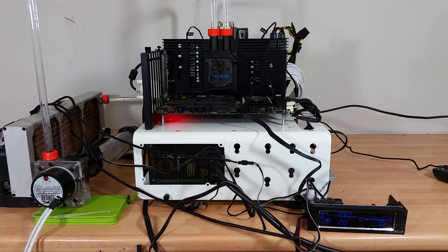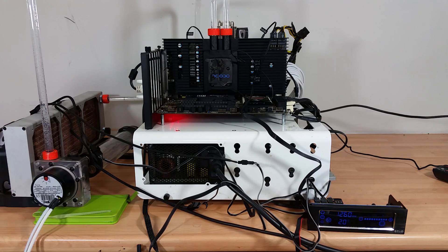In terms of what I'm using: I've got the Alphacool block, an XSPC D5 pump with the 8K top, an XSPC AX 360mm rad, three Phobya fans, and an Alphacool reservoir. The tubing and fittings were not my first choice, but due to various complications I've had to make use of what I've got to hand — some rigid tubing and some Primochill fittings.